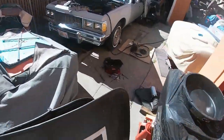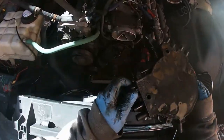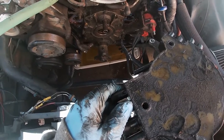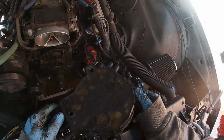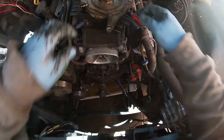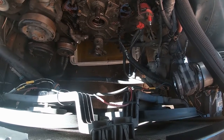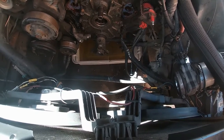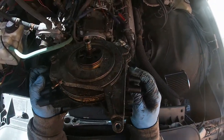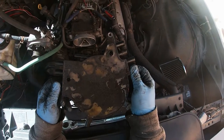This comes off, so don't lose that. This has no O-rings on it — so you can see you're getting oil all day. It was spinning around and that's why the front of my water pump is so dirty. It's the only way you get that much oil on there. The cheap person in me wants to just slap some O-rings on this thing and throw it back in. I shouldn't do that though. That is not looking that bad actually — I feel like I know where the majority of oil was coming from, and that's these missing O-rings.